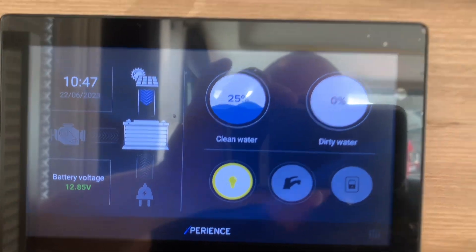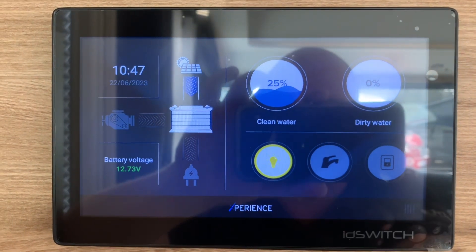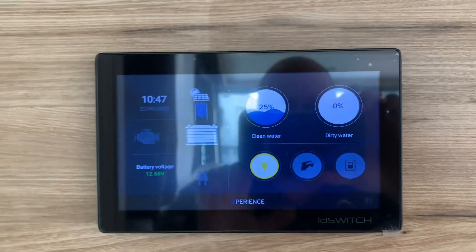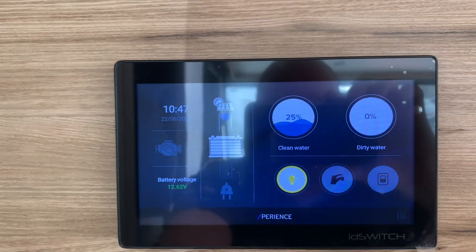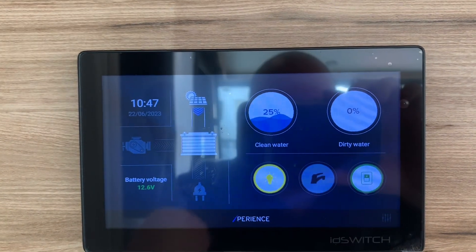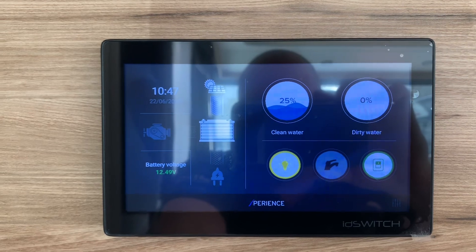Lights, as you can see, is going to turn on the lights — the same lights we saw in this vehicle earlier on. We have water pump, which will turn the water pump on — I won't leave it on because this vehicle is drained down for the most part — and you can see that turns the water pump on. If you have a pressure-based pump, your water pump will immediately start trying to operate if it needs to, but if you have a micro-switch-based pump, this just provides power to it and you still need to operate a tap for that pump to run. We then have auxiliary — if you have anything attached to the auxiliary, that turns on that circuit and allows you to power anything connected to that side of the control panel.